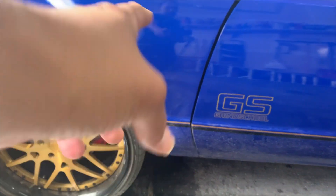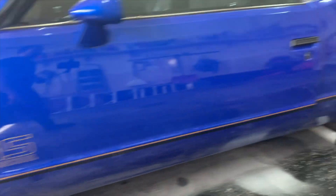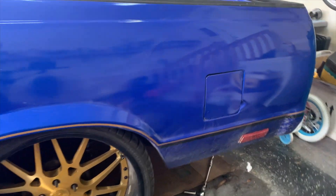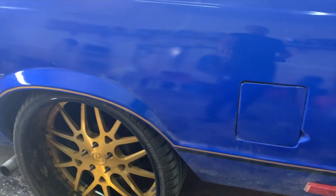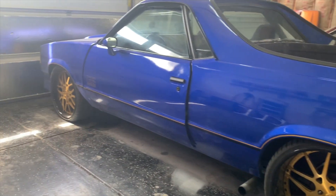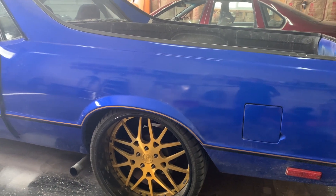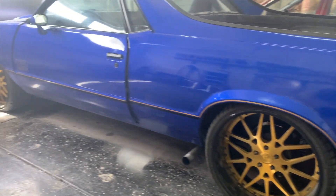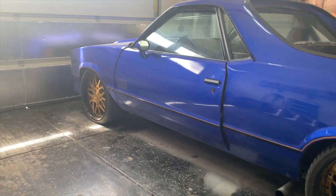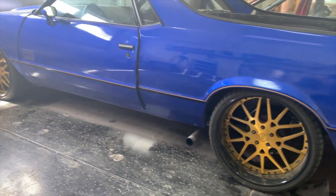This body bushing up here — I went up under there to PB Blast everything, and that one's loose. I already loosened up the one in the furthest back position. I'm going to loosen up all the ones on this side, then go loosen up the other side, and do one side at a time. I'll lift the body up a little bit on this side of the car, replace all these body bushings, then do the other side, and I won't tighten them all the way down until I can tighten every single one of them all together.